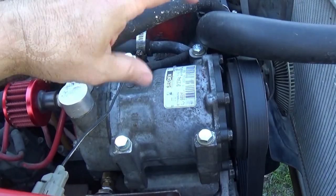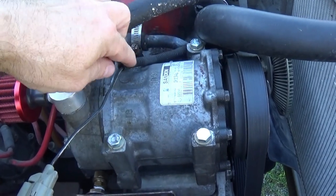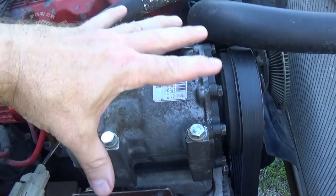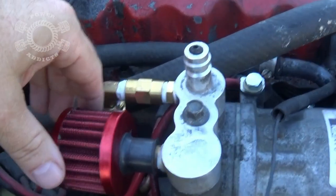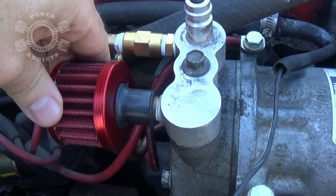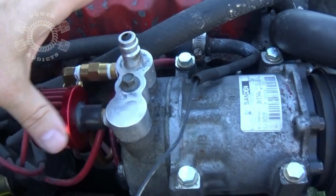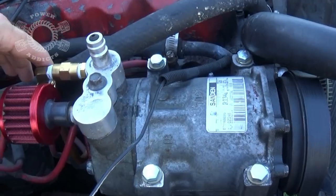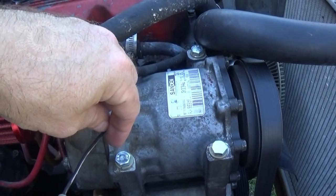The route I went, I took the whole compressor apart and cleaned all the junk out of it. Inside there, all the bearings, thrust bearings, and stuff like that, I greased all that up, and it works absolutely phenomenal. So the only thing I have to do is keep an air filter on it. That's all I got to do. I don't have to put any type of external oil source or anything. Whenever I want to use it, I simply turn it on with the engine running, and it does its job. Down in the description, there's a video on how I did that modification, so you guys go check that out.